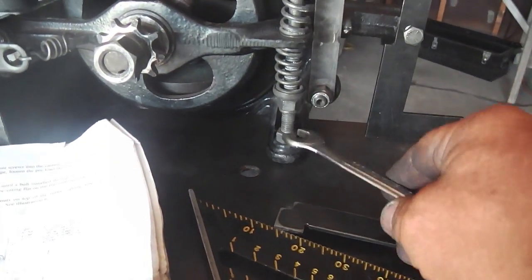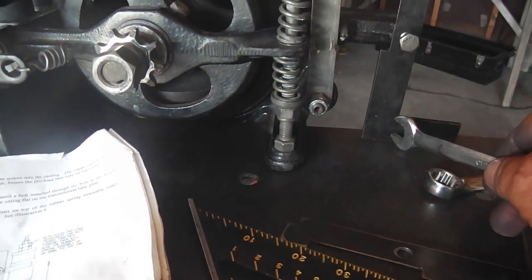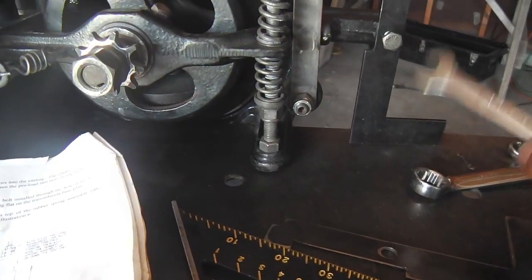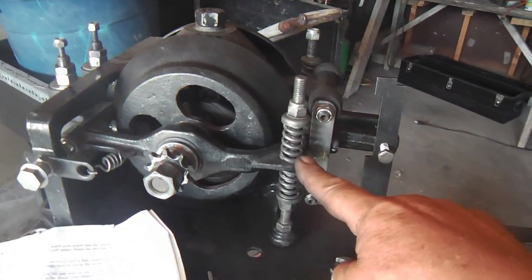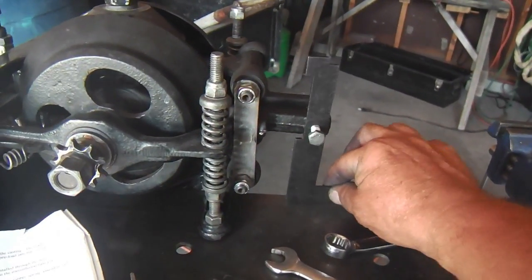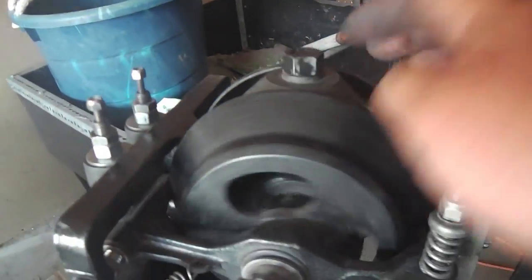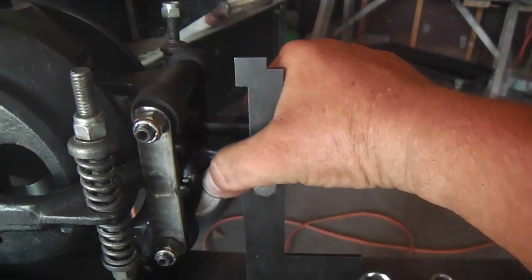That's neutral. You just bring this one up and give it that gap, and then you'll have this ride up, and then you just drop this down until that doesn't ride up anymore. Easy peasy. Okay, and sure enough, driven down, flush down below here. Maybe you could take another turn. But yeah, I'm liking that. We still have no touchy, and this gap here, it's seeming like 50 thousandths.